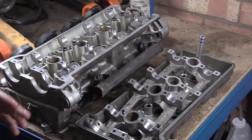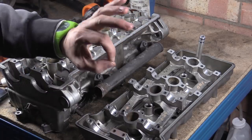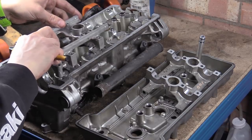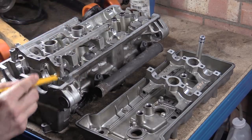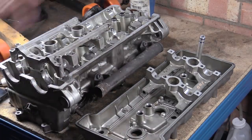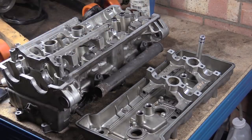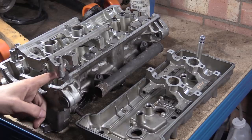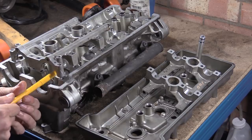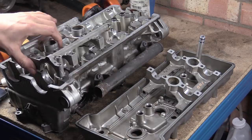And the problem with stuff like this is, as this hole wears, these cam cap carriers, we'll use this as an example, are just bores that are line bored all the way through. That's why we have these cutouts here and there, so we can line bore the whole thing and give us access with our tool. So we'd have a tool like this, spinning away and cutting and line boring, and then they'll literally hone them like that. Once that's happened,